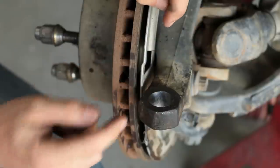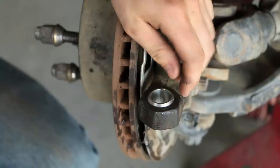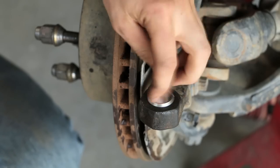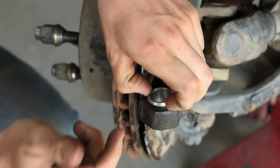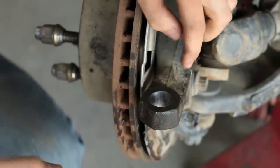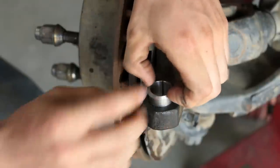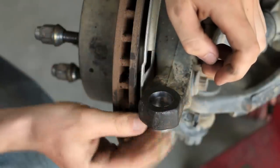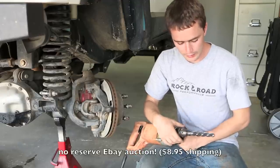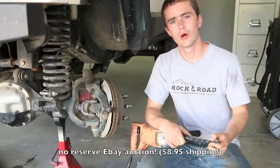As soon as you have your seven-eighths hole bored through your knuckle, you can drop your GM tapered insert right into place. One other thing — if you do this, you're also not limited to over the knuckle or under the knuckle in case you have clearance issues. If you go with this option, you just drill a straight seven-eighths hole and you can go on top as well as on the bottom, no problem. By the way, a reamer like this can be had for pretty cheap — this one is made in the USA and I bought it for $1.